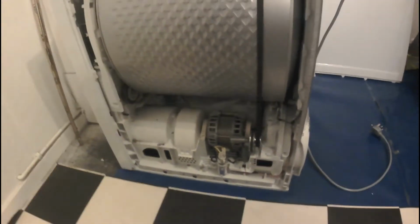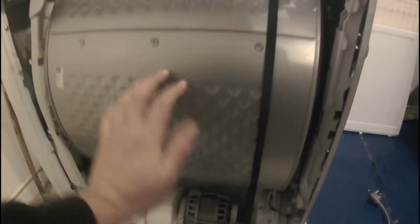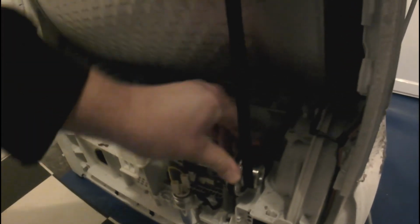If you want to test the bearings, the best thing is to just move the whole unit and feel how much resistance it generates. And I think it's going as smoothly as it was in the beginning. On the other hand, I can just move the ventilator itself, and the unit is moving. So it's definitely not related to the bearings. And these pulleys look like brand new, so all belts look great. Another thing is the wheels here supporting the drum, but as I said, they don't generate a lot of resistance.